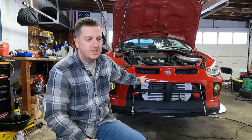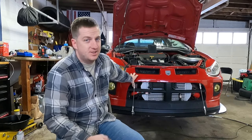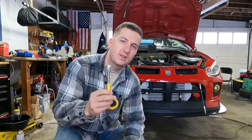If you know anything about these front ends, it's all sheet metal folded into a random shape, tack welded together. The frame rails in the front end are just thin sheet metal. My crash bar has been removed and I made my own out of steel. So I need to figure out if I'm going to modify the crash bar to accommodate this — I just don't know if I'm going to drill a hole in the bumper or do something different. We're going to start by removing the front bumper and front splitter, getting everything out of the way, then figure out what we need to do.